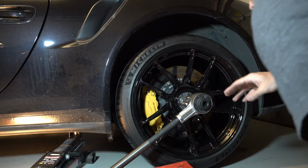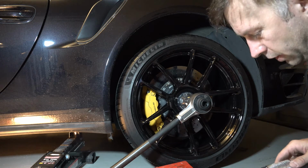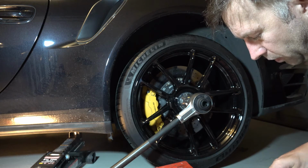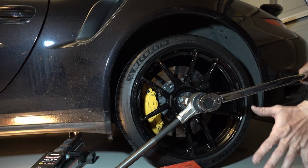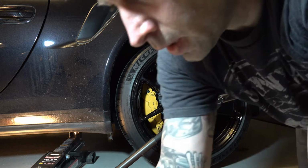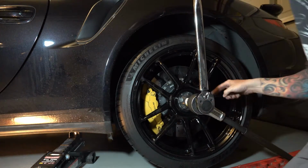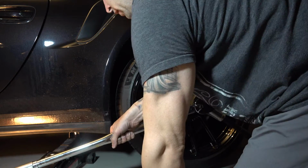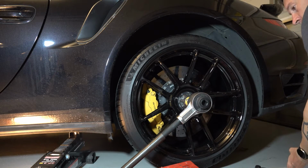So I know we don't want to overdo it, we don't want it to come loose. So let's say if we go 10% would be at 220. And so there's 237. Maybe we go to, so there's where the torque is. Now the manual says you back it off a quarter turn and then retighten it to that same thing. Okay, and a quarter turn on this means it's got to go from here. Okay, there's the quarter turn. Okay, and that should be it.